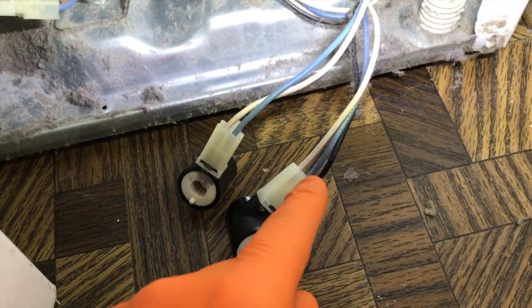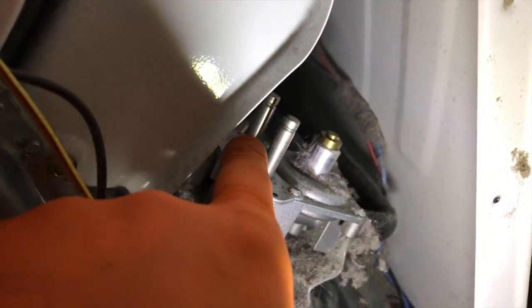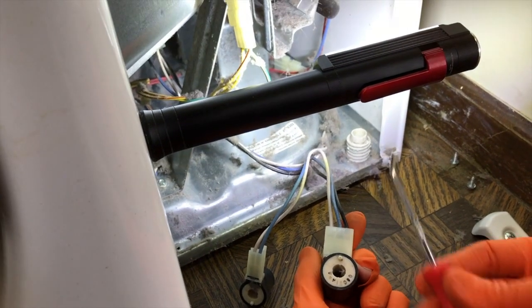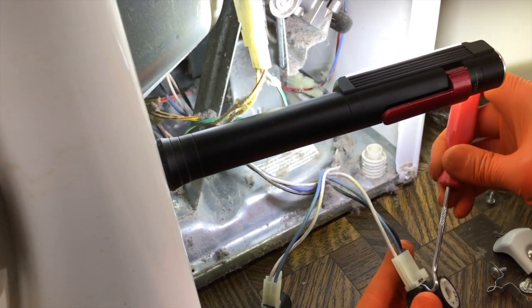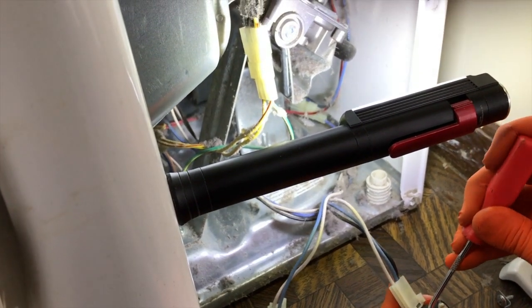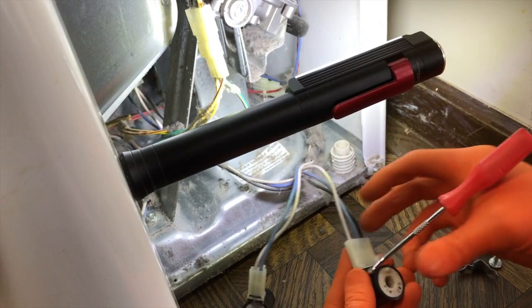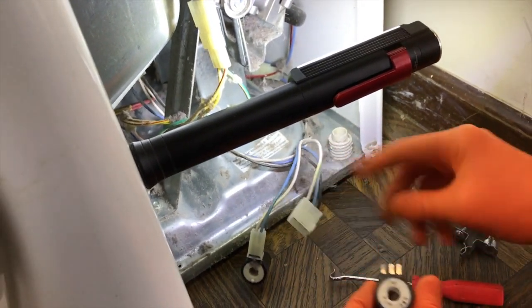Notice how this has three wires: white, blue, and black. That coil goes on the first rod here. The coil that has blue and white and only two wires — that is the inner or far rod. This is a pick tool from our local AutoZone; it's got a little tab that loops onto a clip. Very carefully, just lift this up and remove this connection point from the coil — just like that — and do it for both sides.